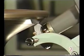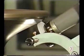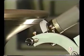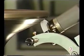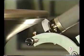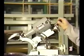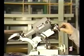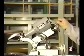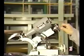Set the cutting degree to 0.01 millimeters or less, and grind the valve seat from the inside to the outside. After completing rough grinding of the valve seat surface, replace the grinding wheel with the finishing wheel. Perform the finishing grind at a cutting degree of 0.005 millimeters.